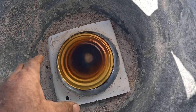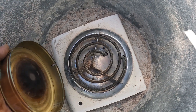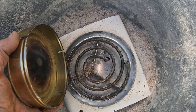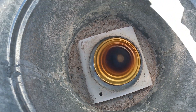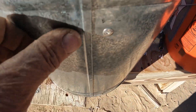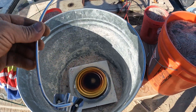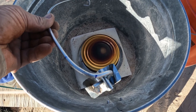I made this cover for the grill element because some of that sand was moist and it was causing it to corrode, so hopefully it doesn't interfere with the heat much. I took the handle off the outside, put these pop rivets in the existing holes, and cut the handle down to this size so I can mount it on the inside with the original little brackets.